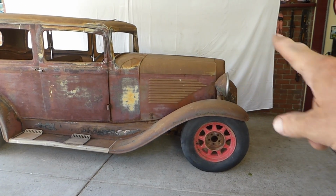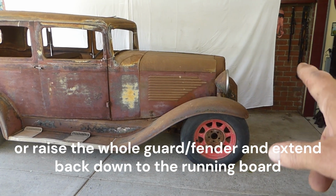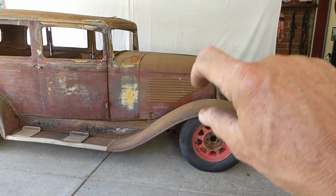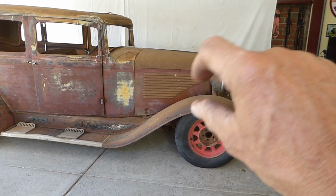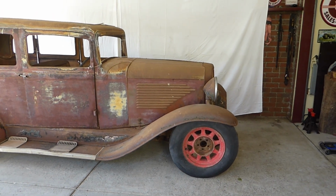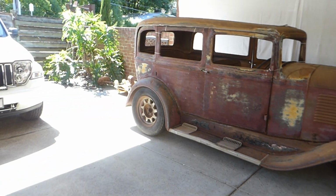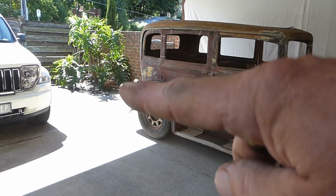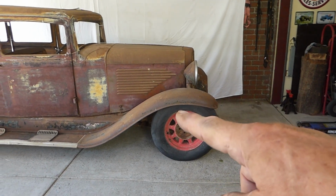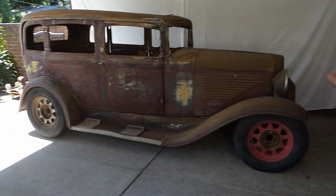And I'm going to have to radius the middle of that up higher too, and make that come round more, and I may or may not raise the centre of that the same. So rather than increasing the thickness, increase the arch over the wheel. So I've got literally enough suspension travel. I've only got just over 2 fingers at the moment, and I want a little bit more. The height from the ground to the bottom of that lip there is 4 inches taller than on this side here when it's level. That's just how much lower these guards sit than these ones, so there's plenty of scope.